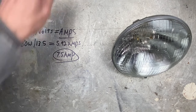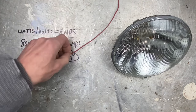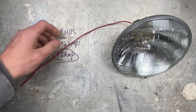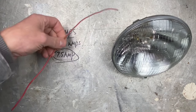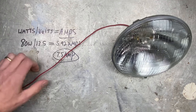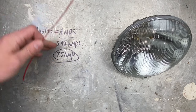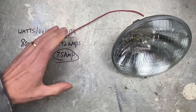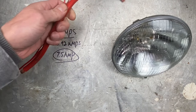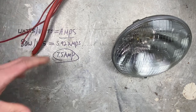But again, don't forget about your wires. In this case, you don't need 4 gauge wire because that'll do 100 amps — that's way overkill. This is 16 gauge wire, and 16 gauge wire will do 10 amps over 20 feet. I keep picking the 20 feet measurement because most cars are about 20 feet, and that's a good number to go with. So this 16 gauge copper wire is perfectly okay to run a pair of these headlights with a 7.5 amp fuse. There are charts that show you what different wire sizes are rated for in terms of amperage, and these charts are everywhere on the internet — I'll link one in the description.